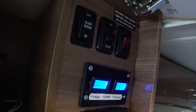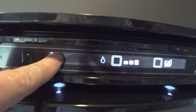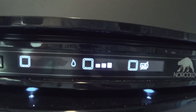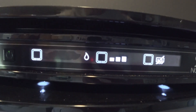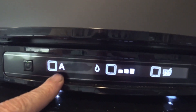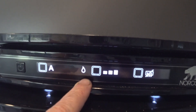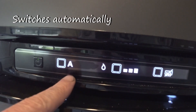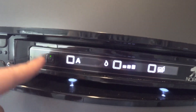For operation, usually use the LP gas — turn the gas on, hold that button and switch it over to gas, and it'll light up. That's the normal operation. However, you can switch over to automatic mode, in which case it'll run on gas, but if you're plugged into 115-volt electricity, it will switch to electric and then go back to gas when unplugged. That's the best way to run it, and how I leave it.